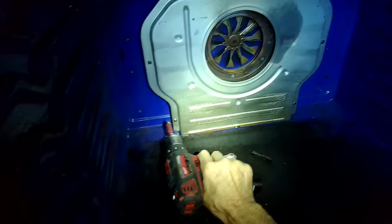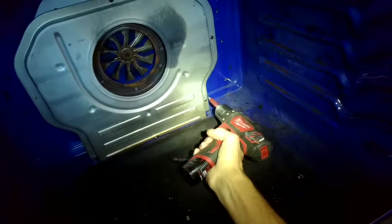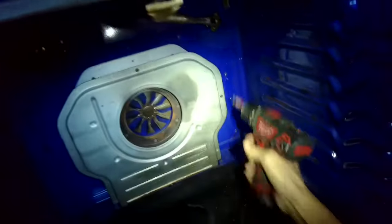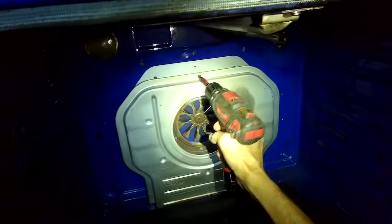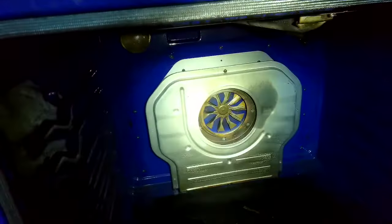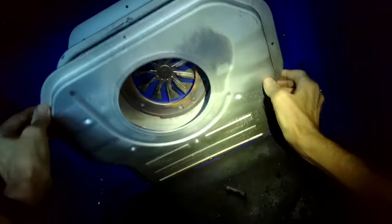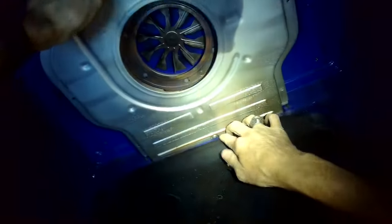We just got off that piece, and then there's another panel we have to remove — same thing, just has a few peripheral Phillips head screws. Once we get that panel off we have access to the burner tube and to the igniter. These are really easy to replace igniters. We're going to use a standard Frigidaire Electrolux igniter from Amazon — they're only about seventeen dollars. We'll put a link in the description below so you can easily order it. This panel just comes off — we're going to lift up and pull back at the same time.